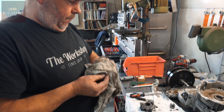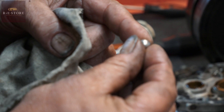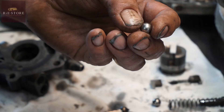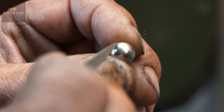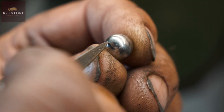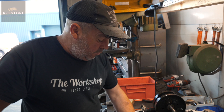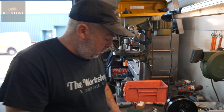If they've had water in them, look for any ridges, lumps, or circles where it's just been sitting. That one looks alright — these are just standard; go to a push bike shop and get a 3/8 ball bearing. See that line there? That's a mark on the ball bearing running around it, and there's another scuff mark — that means it's caught on a ledge somewhere in one of those holes. So you rub that out and put new ball bearings in. It'll cost you 15p for three — it's a no brainer. If in doubt, change it out.